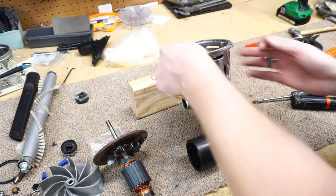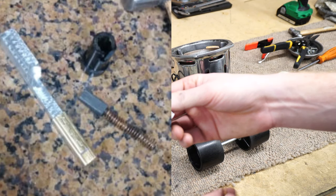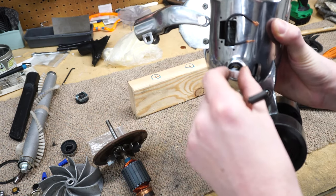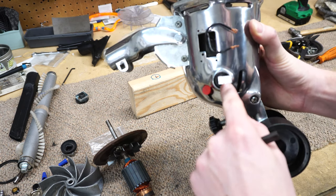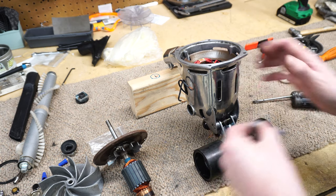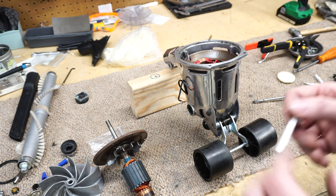The solution ended up being — and maybe I'll put a picture up — I had to machine something the same size as the carbon brush on my milling machine, take the brass part out of the bakelite, bend it with a hammer, get it right back to the right size, and then reinsert it. That whole process took about two hours after the manual machining and everything.